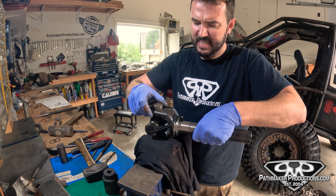Fill this full of grease and put this thing back together. Before we hop to the other side, we wanted to quickly explain what you do if you end up with a tight U-joint. When I put this side together it was a little bit tight in one direction, which means the ears on the yoke were splayed out slightly. I pulled it back out, gave it a few hits on either side, and it tightened up the yoke — now it's working great. That's how you swap U-joints: Super Joints are a little more involved, Spicer joints a little easier, but the process is all the same. Happy wheeling everybody!